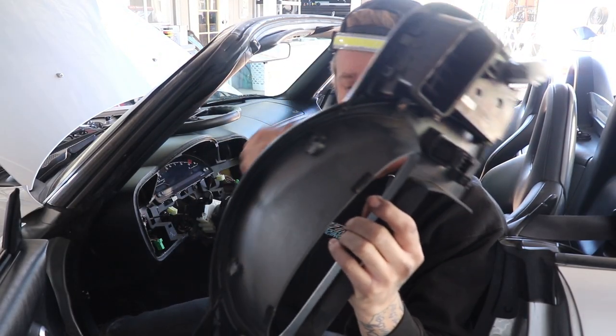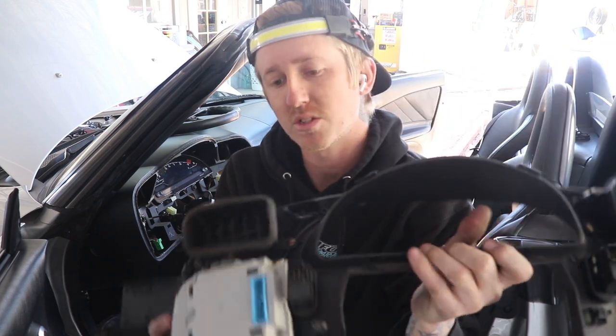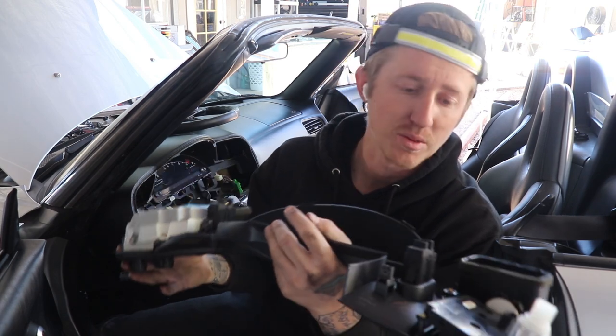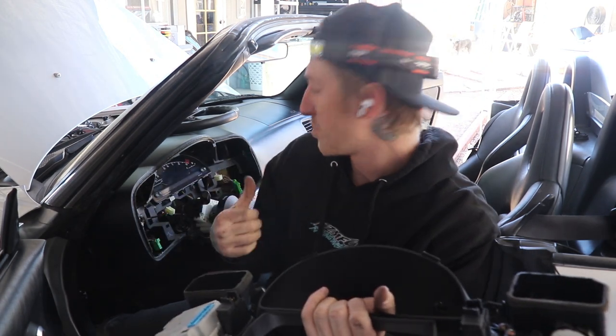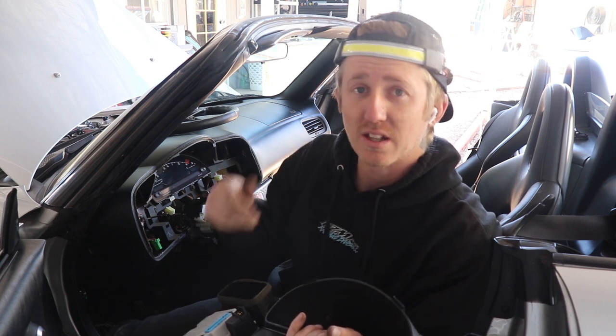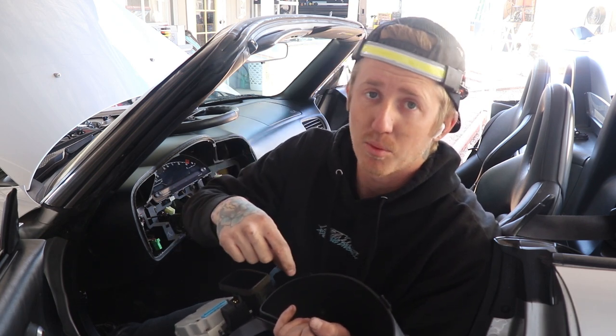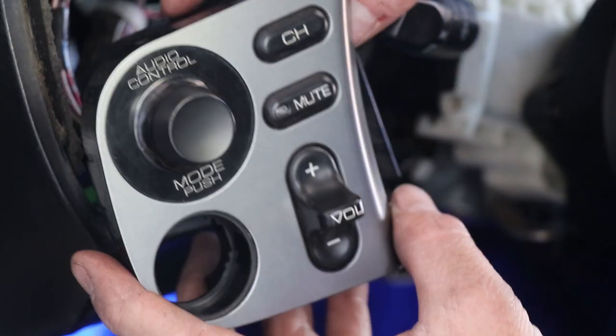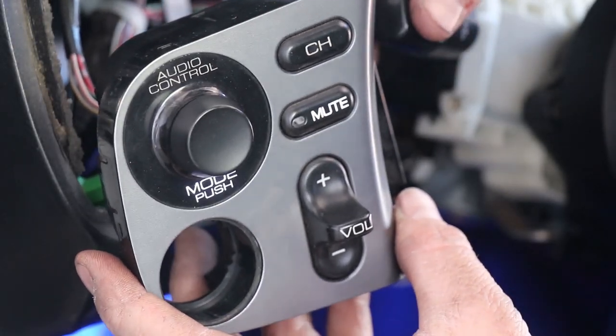With the bezel out, it's a little hard to see on camera but once you look on the backside you can start seeing all the bulbs on the back sides of the switches. I'm going to start pulling bulbs out and putting new bulbs in. I'll plug in the piece I already have bulbs installed in to test if the lights come on. Sometimes LEDs are finicky - if it doesn't work one way you usually have to pop them out and flip them 180 degrees. Best advice: plug everything in and test it before putting everything back together, so you don't find out half of them are facing the wrong way.